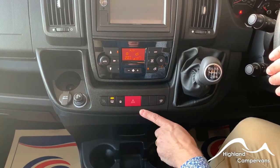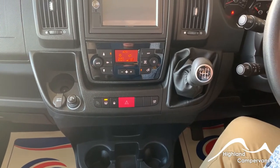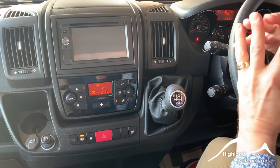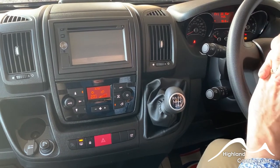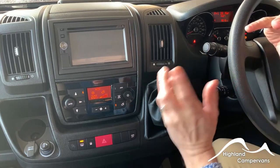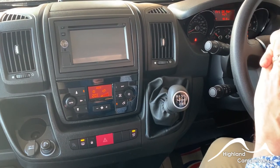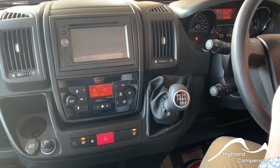Hazard light switch is self-explanatory. ASR is the traction control system — front wheel drive. For the most part it stays on, so if you were driving aggressively on a loose surface the wheels would try to slip, the engine would cut in and give you engine braking to stop that wheel slippage. If you were wanting to drive onto wet grass or ice, I'd recommend switching it off so you have direct throttle-to-wheel control and can control how those wheels grip.